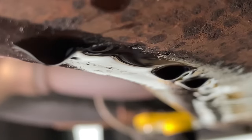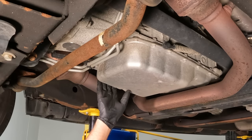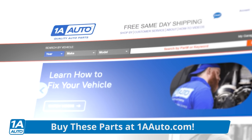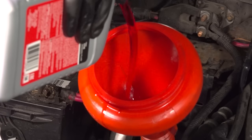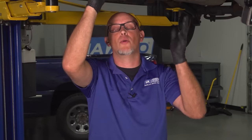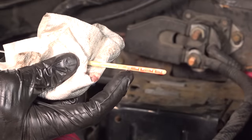When you're having transmission issues, one of the best case scenarios would be that you have a transmission leak — whether it's a pan gasket or oil cooler lines — all of which you can get at 1AAuto.com. Then all you have to do is top off the fluid and you should be good to go. But there are some exceptions: if you have a newer vehicle, a lot of them have computers that sometimes glitch out. So if the fluid looks fine, doesn't smell bad, and appears clear and red, you may have a computer issue that's going to have to be taken care of by the dealer.